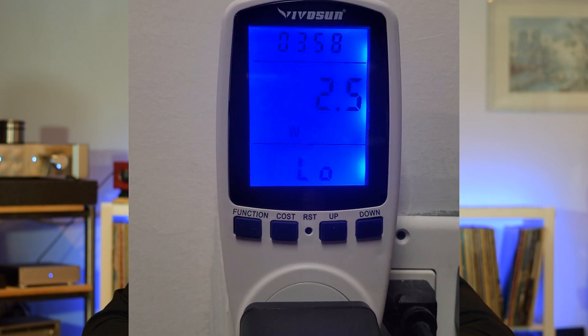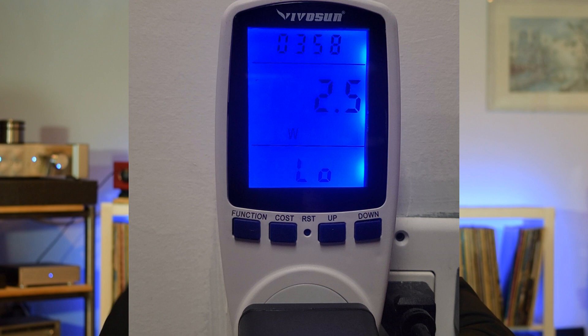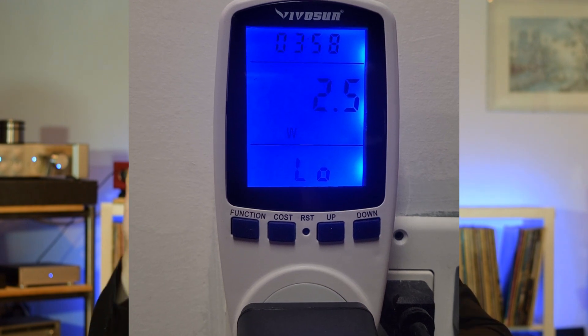All that's held together in a nice aluminum case, held together securely. It feels good and it's a quality little unit. When you plug it in, I found it's very economical on electricity usage — it seems to be drawing only about two and a half watts from the wall. The power switch is on the back, so if you leave it plugged in and turned on all the time, it's always warmed up, ready to go, and it's not going to take too much power.